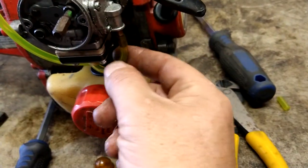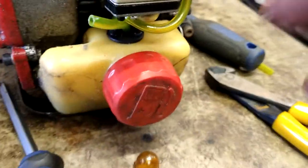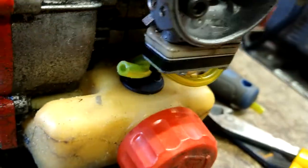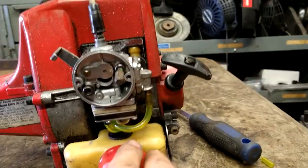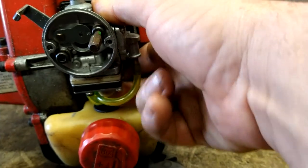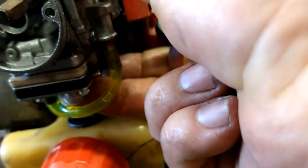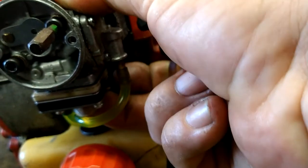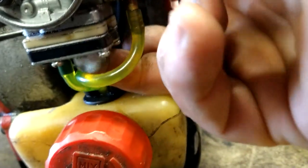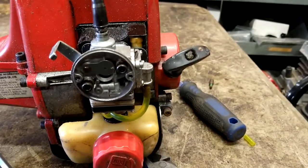The short line goes to this nipple — that's fuel in. Follow the extra fuel line and stab it down on that black one. Put some gas in it — I already have gas in it. We're going to try priming it up. I hope it primes. It's not looking good though. Oh — it primed! Let's see if we can get it to run. Let's hope it runs. Cross my fingers.